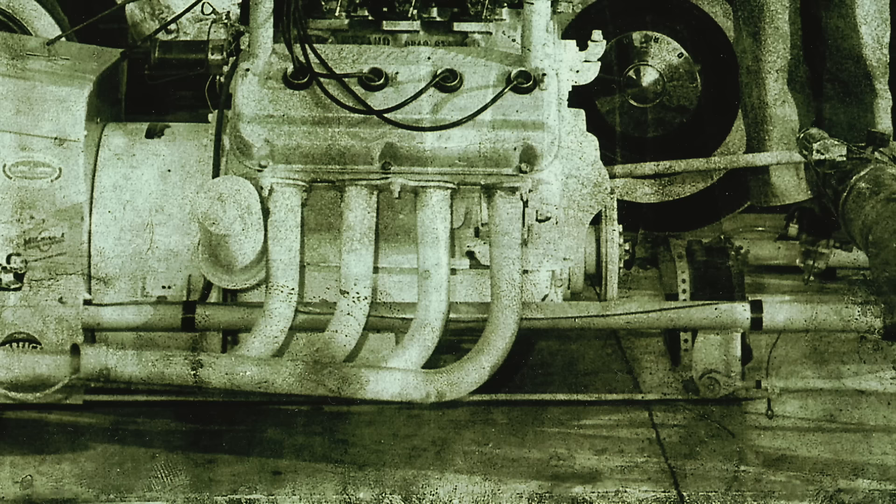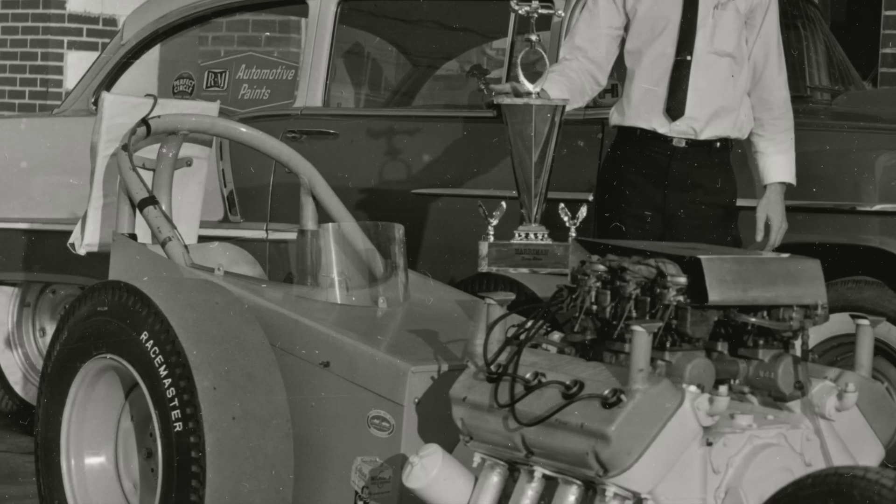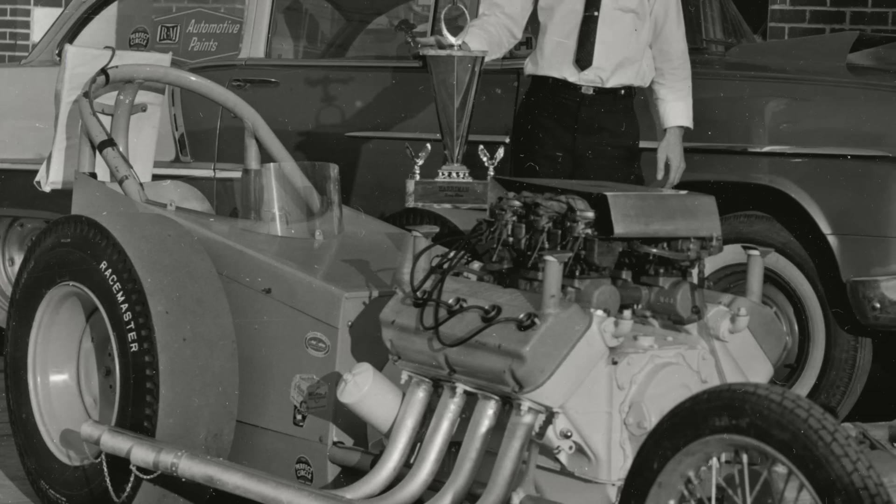He used inch-and-five-eighths tube for the majority of the chassis, with a little smaller tube for the truss supports. He gas welded it. The only curved piece on the whole car is the main tube that goes around his head — he couldn't bend it himself and nobody around had the equipment, so he took it to the local plumbing shop, brought it back, welded it on, and had his bare chassis.